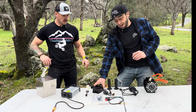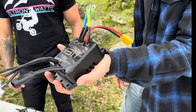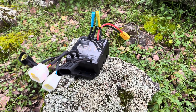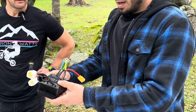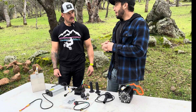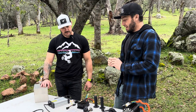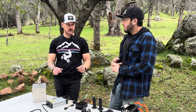The Little Bit is really small — it fits in the palm of your hand. It's essentially taking a Noisy Cricket and cutting it roughly in half. It can do 300 phase amps and 120 line amps. It's fully waterproof and potted just like the Cricket, with a solid billet body and a plastic top. It's essentially just a little bit less than a Cricket — and that pun is very intentional.